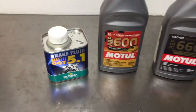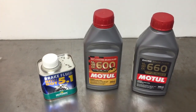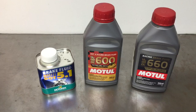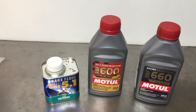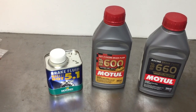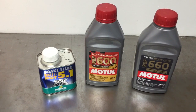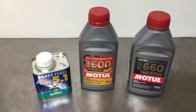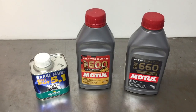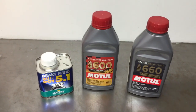To back up a little here, there's basically two types of brake fluid. There's a silicone-based — that's DOT 5.0. Then there's alcohol-based — that's DOT 3, DOT 4, and DOT 5.1. Those are all alcohol-based. The alcohol-based fluids can all be mixed together; the silicone cannot. And you cannot use the silicone-based 5.0 in a system that's designed for alcohol-based.